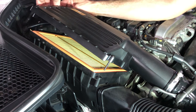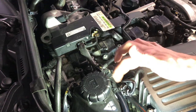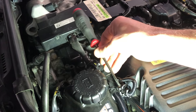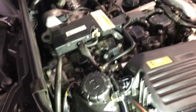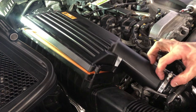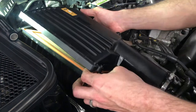There is a little clip on the back that I almost forgot about. There's a little air filter sensor on the back of the box, facing the rear of the car. Pro tip: take a small flathead screwdriver and go up behind this piece — there's a little clip. Take your screwdriver up underneath the face of the clip and you should be able to just pull it right off. Once you've taken your connector off, lay it to the side and then take the box off. Remember, I loosened this band clamp enough so you can spin the filter box, but it has ribs so it won't just come out easily. You can lift the box up enough and pull the filter out.